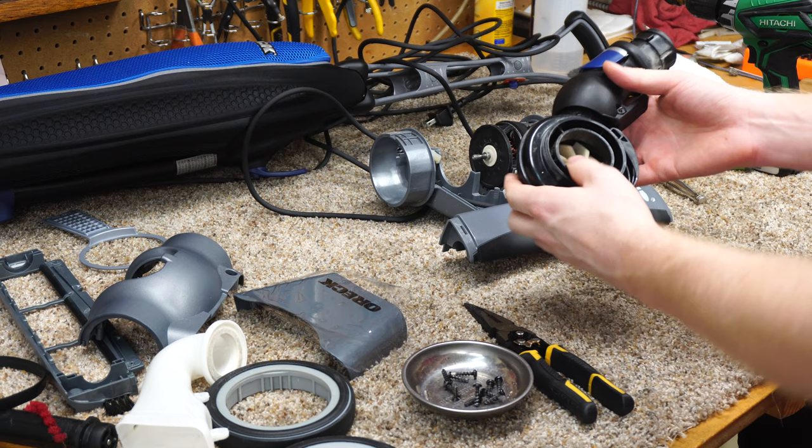High, low — and the bag should pop up a little bit when you do that. While we're on the subject, you can take a coin or a very large screwdriver and rotate this a little bit to access the battery in there. Sometimes these batteries need to be changed — I find they're usually good for years on end, but if yours won't turn on, that's something to look at. You can also hold this button right here — you'll see it blinks — and that re-syncs the Bluetooth connection. That shows the radio frequency part of the handle, which is really unique to this vacuum. If you learned something today, hit the thumbs up. Consider joining our Patreon, hit subscribe, consider sharing, and have a wonderful day.